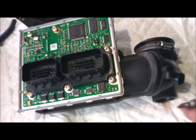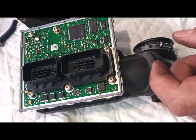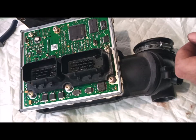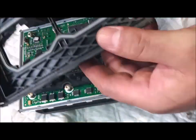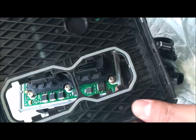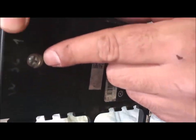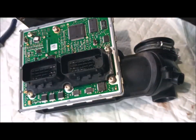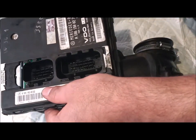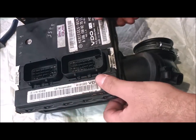This summarizes the Air Mass Flow problems on the A-Class Mercedes. This is the first video online showing the continuity and resistance values between the two filaments — the heater filament and the resistance filament. If you get a replacement unit from a company, make sure all the gaskets are present as shown, and that the unit should be properly closed — this hole should also be sealed.